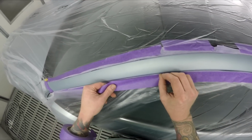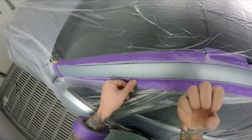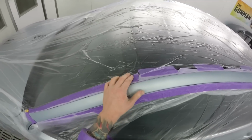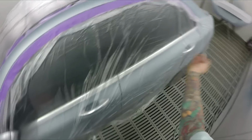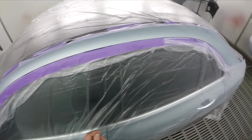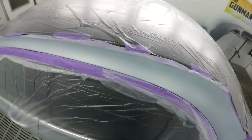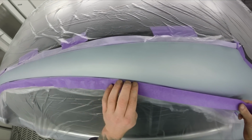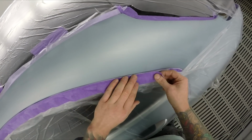It was a VE when that was still pretty new, and I found with this system, if I put wet on wet primer down, for starters it's going to pinch up and die, you'll lose a bit of the gloss. Also I was spraying the whole side of the car, and you get wet on wet primer all through your door gaps, and it actually takes longer than just putting an extra bit of green down.